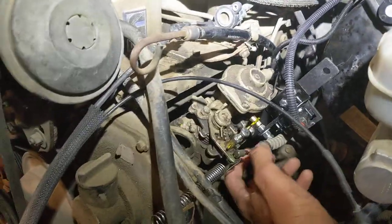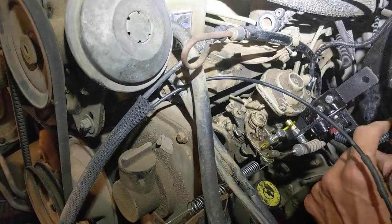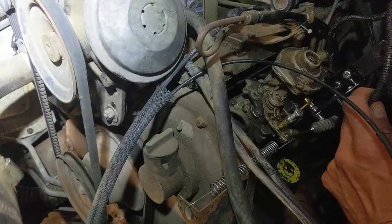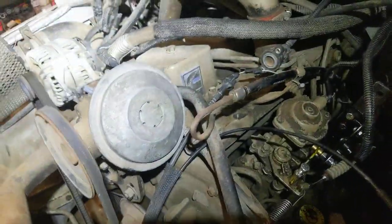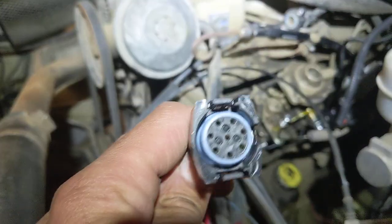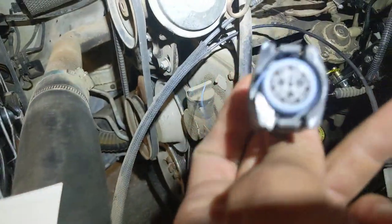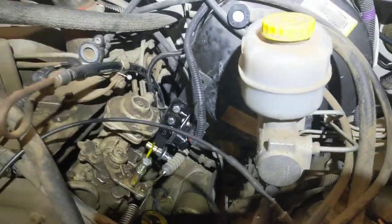I'm showing here one of the most important things for the 47RE — it needs to have a throttle position sensor. This is a TPS that I put in, an aftermarket one that I purchased. I'll also talk about the standalone transmission controller for the 47RE. This is the plug for the 47RE — it requires eight inputs, an eight-prong connector. It's the RE, so again electronically controlled, and it needs to know quite a few things, including the throttle.